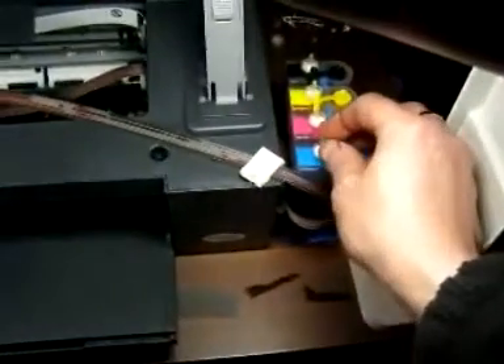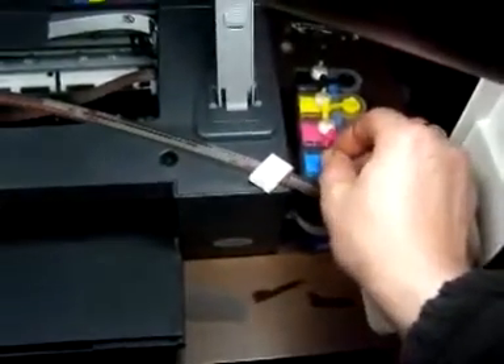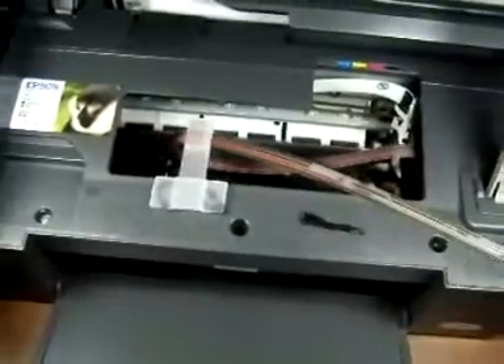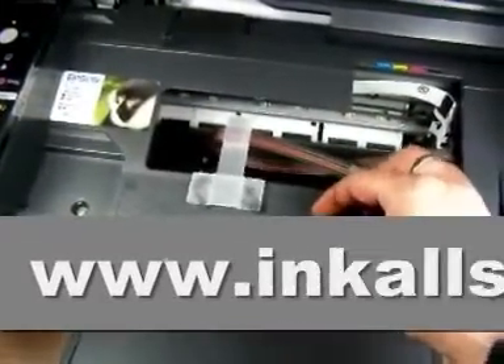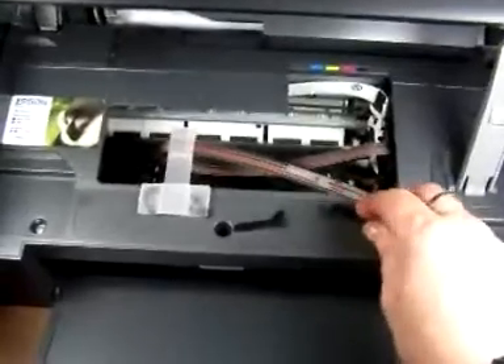Also, you've got to have these little air filters in here. You take the small bung out and put your air filters in — let the air in, but won't let it fly out if you accidentally knock it, and won't let ink go everywhere. You leave the big bung in. Don't forget you've got to cut these off — I used a hot knife. Use whatever you want, but I don't recommend sawing it. But I must say, if you use a hot knife and burn yourself, then it is not my fault. I can only tell you how I do it. There are two pieces off each side of this cartridge carrier.